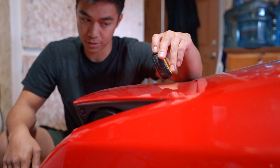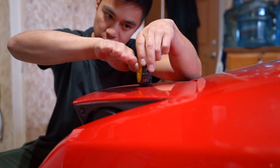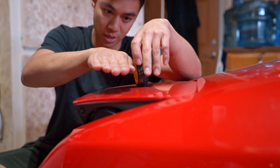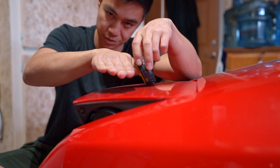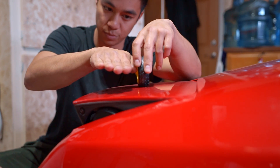The challenge now is just finding that balance. Drive aggressively and watch how your tire wears. If there's too much inside wear, you've got to bring the tire back in. If there's too much outside wear, you need to add some more camber. And that's the main misconception on camber — everyone thinks having your wheel out like this increases grip, when in reality you want as much tire and as much rubber as you can get.